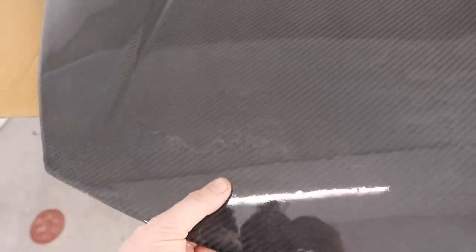But then we also got something that looks really similar while we were sanding. So I think what happened is when we went to sand, the resin wasn't totally dried up enough, and instead of sanding stuff off, we gunked it up and infused what was left of the resin with some sanded dust. I think that's what it was. So that was not cured by spraying clear coat over it. It didn't clear up or anything like that.